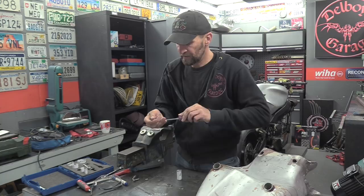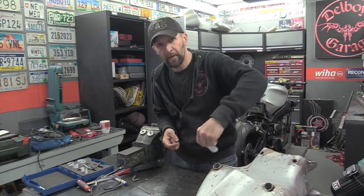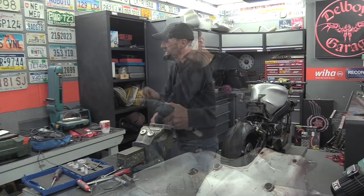And the easiest way to use these things: there's a drill bit that comes up the middle to help you center the hole. I don't need that because I don't want it to go chewing the hole out in the bottom. So just take the drill bit out of the arbor, screw that into the arbor like that. Then I can mount that in the drill, and that'll be a great little cutter just to cut all that fiberglass out in the bottom. Creative use of your equipment means you don't need to buy more of the stuff.